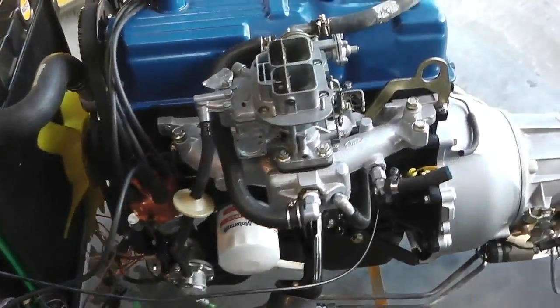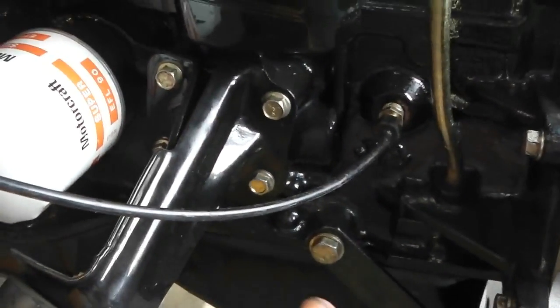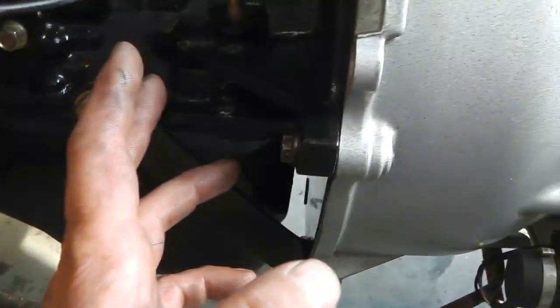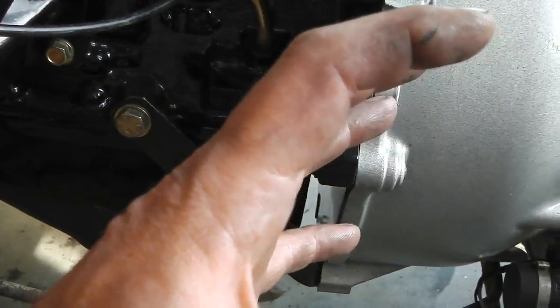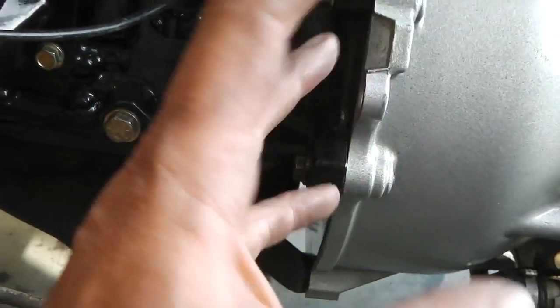I'm going to just carry on telling you what happened with this. We got that on. We talked about those bolts. Okay, they're not 13, so that's good. I'm glad I've learnt. We got the starter motor on. Then we were hoping the starter motor was going to nicely engage with the torque converter, and that the torque converter had pulled its few mil forward as it drew it onto the flex plate, so everything was in line, and that is working.